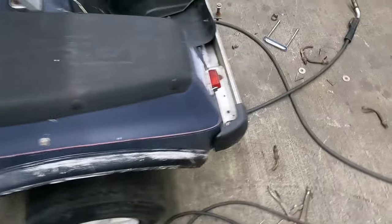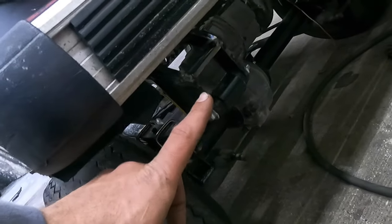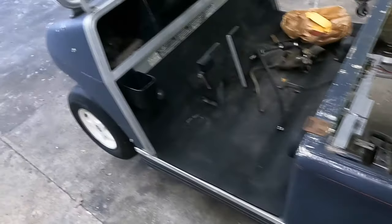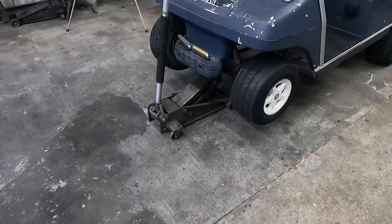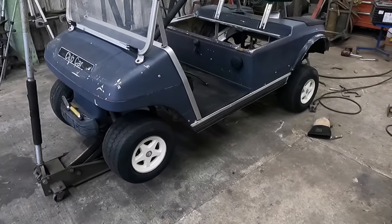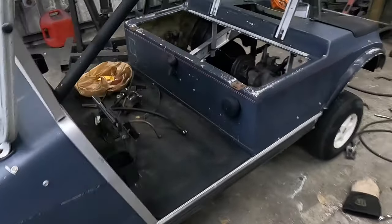I had to modify the rear hangers, which is when I noticed it. I kind of notched them and pushed them forward, and then I welded a crossbar in there to stiffen everything up, and got the jack on the front to simulate what it's going to look like. A lot taller than I was wanting, but I'm not going to redo stuff now.